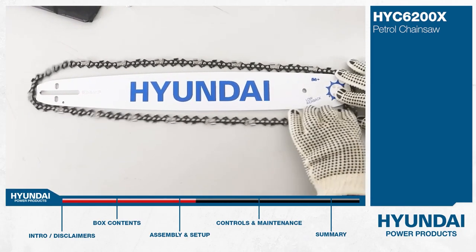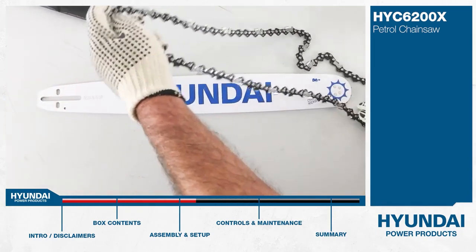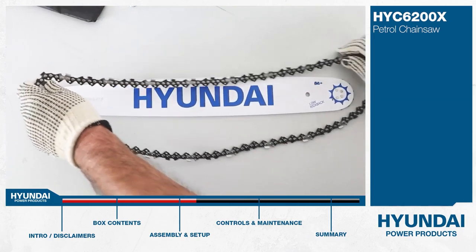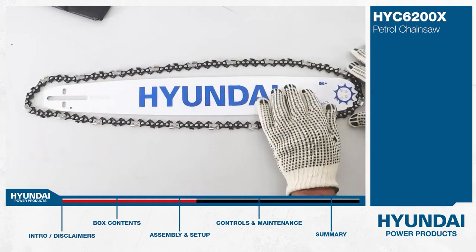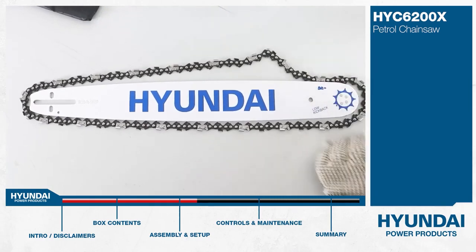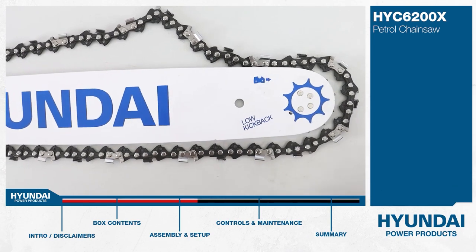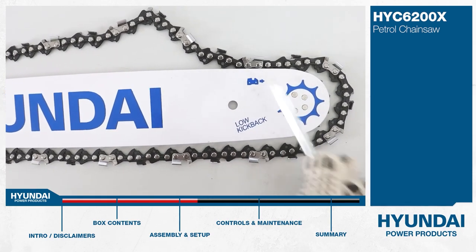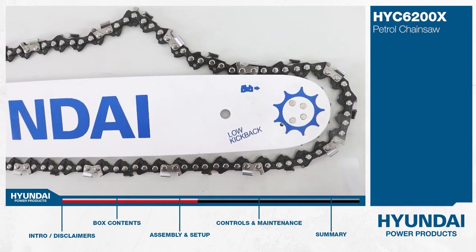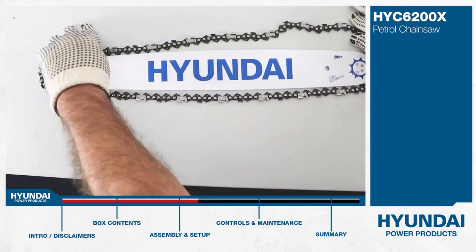If I flip it the other way, now I will note that I'm wearing gloves to do this because I'm handling a chain which is brand new and very sharp. But whenever handling a chain, just wear some protection for your hands, because it's quite easy to cut yourself. So as you can see, I've set it up here now, and that link is the wrong way round, so that chain would be incorrect. So I'll flip the chain again and put it back the correct way round.